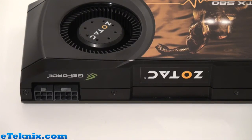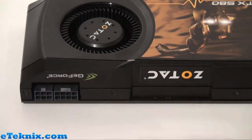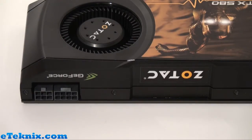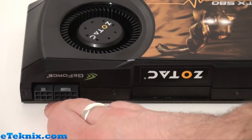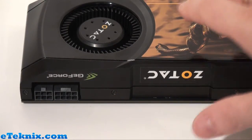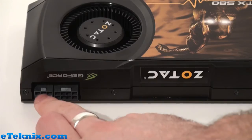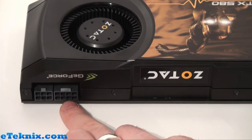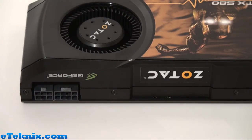A couple of things you will notice on the top of the graphics card is that it has a Zotac logo and a GeForce logo — these are just stickers because this does use the reference design. Underneath the GeForce logo, we can see exactly where the power connections go, and this is quite a power-hungry card. The minimum specified power supply for it is 600W, and you can see that it uses one 6-pin PCI Express adapter and also one 8-pin PCI Express adapter. Please make sure that your power supply is up to powering this.